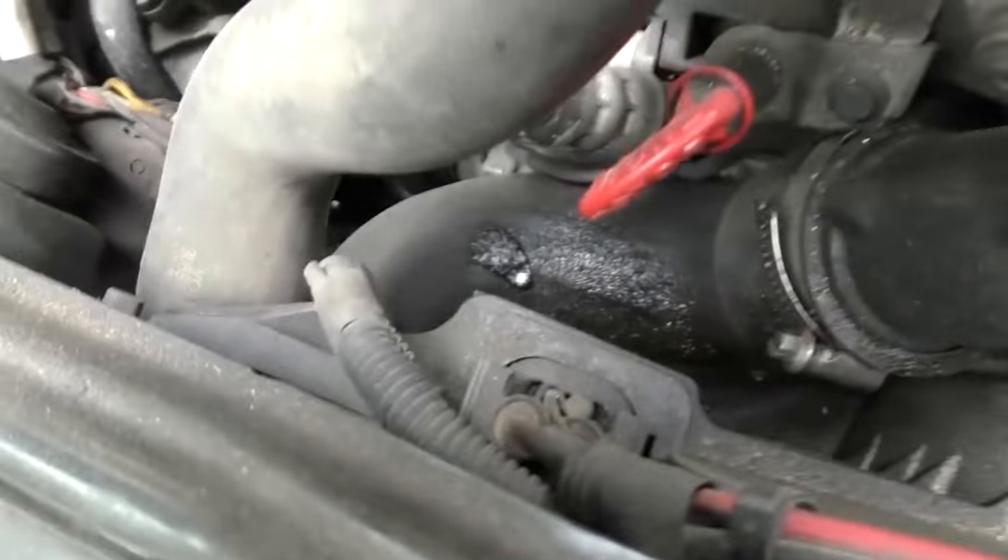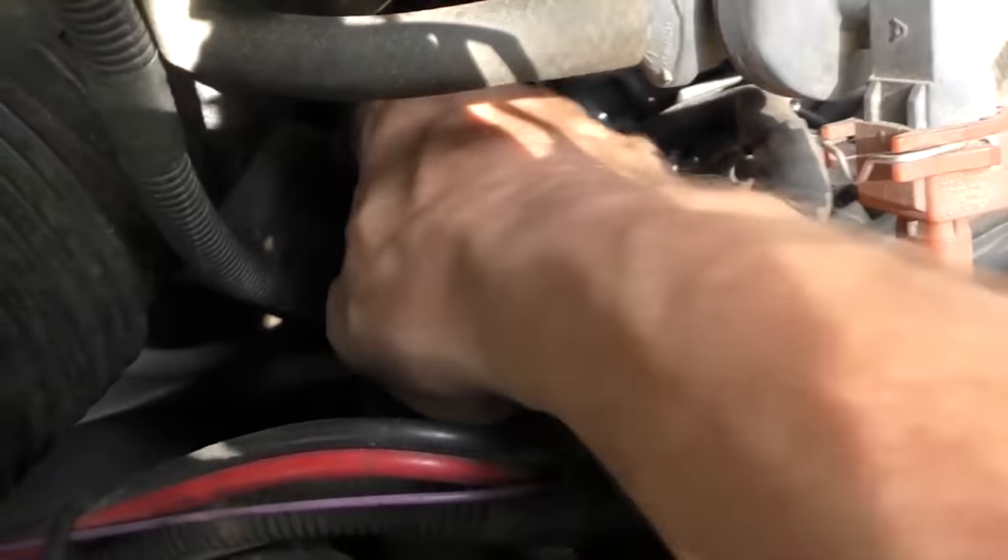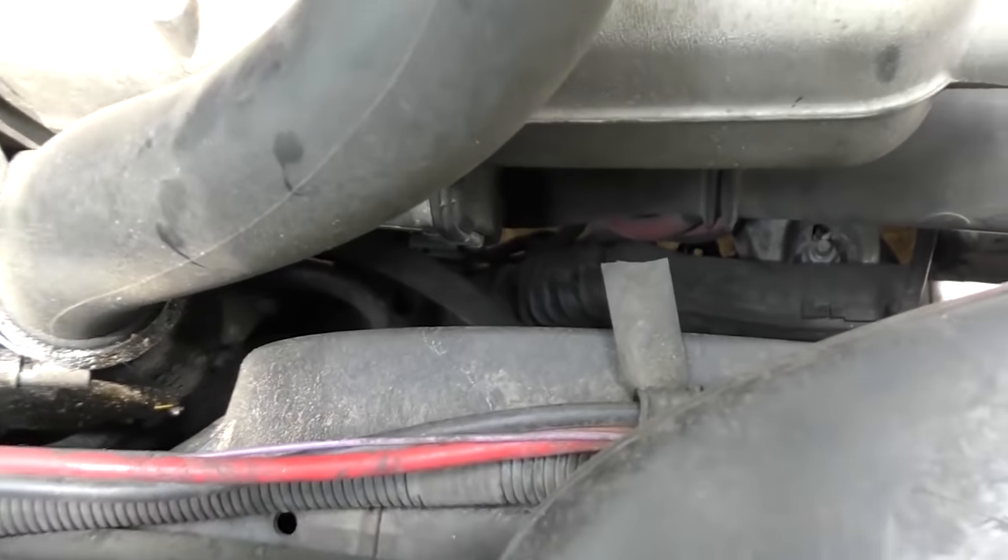Always check the intercooler lines. The upper portion is plastic and can crack. Going down to the bottom it's rubber, and there's also rubber on the other side in front. Check all the rubber sections and the clamps. Generally if the plastic cracks, the rubber comes loose, falls off, or rots and develops holes, the car won't run right because that's where the pressurized turbocharged air flows - any leaks will mess with the air-fuel mixture. It's a good idea to check them every once in a while; it's a simple thing you can do yourself.